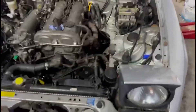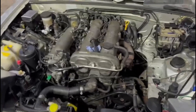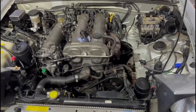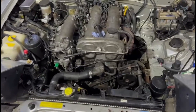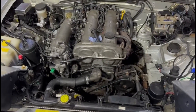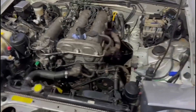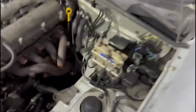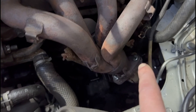So I've gone two steps back tonight but needed to in order to move forward. I took all the front of the engine off again because there were two bolts I'd undone to get the water pump off behind here when I was doing all the timing and everything. There were two bolts I took off the top cam cover plate that I woke up at three o'clock in the morning thinking — did I tighten them back up? So I took it all apart and yeah, I did tighten them up, but I'd rather check and be safe rather than have something come loose. That's all put back together, and then the exhaust manifold — that new bolt there is the one we had to drill out the other day.